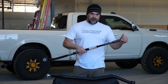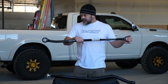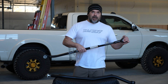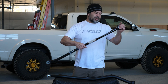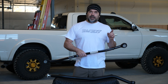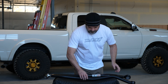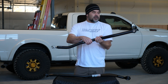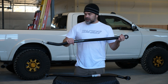While these factory bushings can hold up pretty well for 20,000 miles, it's really mostly on a stock truck where you're not getting a whole lot of movement — maybe three to four inches of travel out of daily use. That's okay on these bushings. Once you put our springs on, now you're getting a lot more rotation, and this small amount of rubber does not like going in that direction. So once you put our suspension on, the factory track bar on 2013 and up trucks can last a little while, but you really should consider it a mandatory part. Our track bar's bushings, however, are free to move 360 degrees, so there's no binding on either end — it's not putting any forces into the suspension, just allowing it to float and move freely.